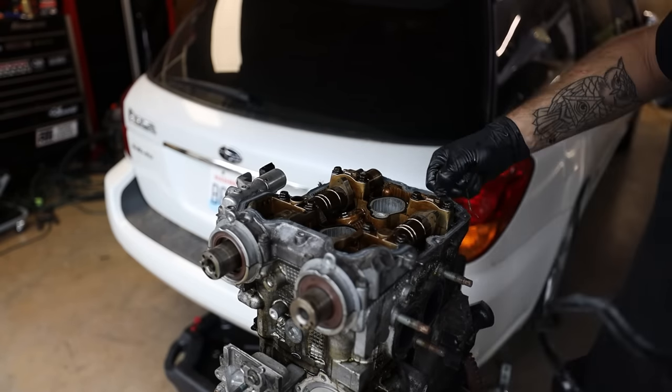This one says 774, 774. On these back ones, you've got 4E774. It's gonna be cylinder 4, exhaust, cylinder head number 774. It even has an arrow telling you which way to put it. So even if you get these mixed up and you don't know where they go, they are all labeled for you, so you physically cannot put them in the wrong spots.